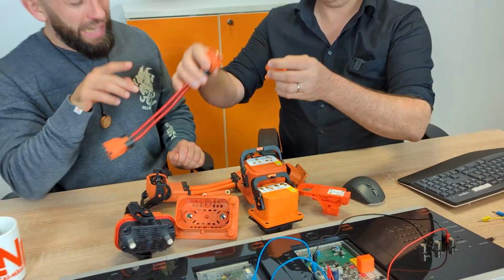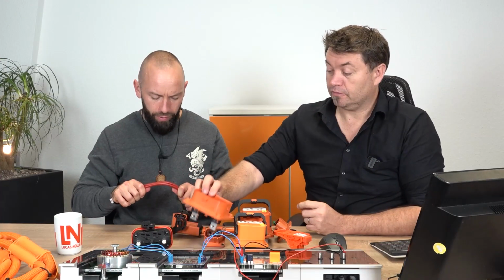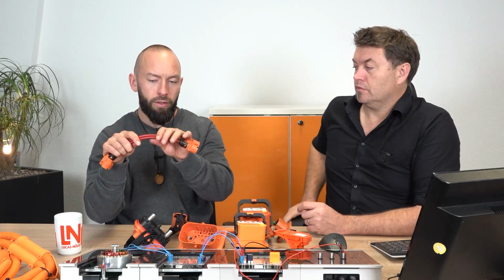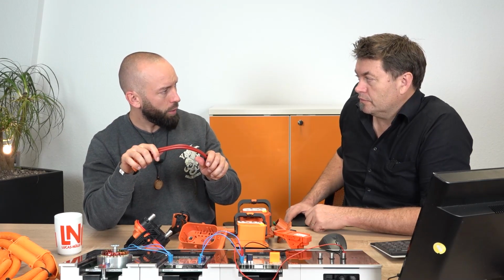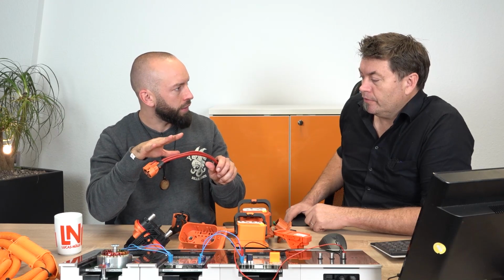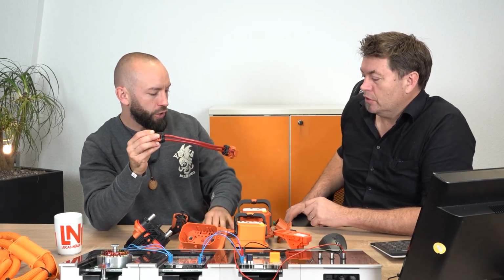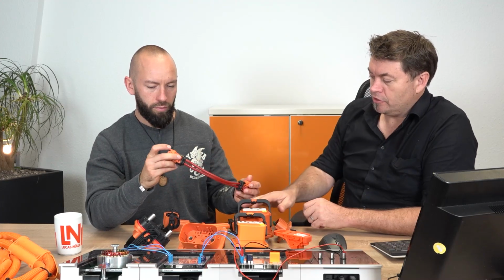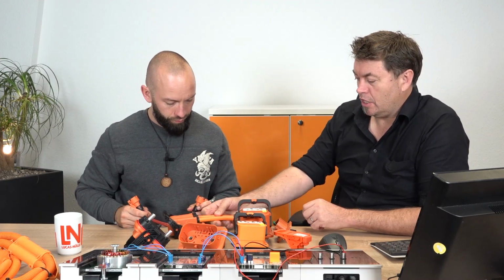But can we classically say, okay, you said these are test cables here, but what you see, and I think that makes sense regarding the color, is that the size or the diameter of this cable is smaller than this. So basically what is running through the AC compressor, the electric, is lower energy than what runs through the battery or anything like that. Basically, yeah, because it looks a little bit lighter here than that guy. So obviously different connectors come in different sizes. It depends a lot on the voltage as well. So the voltage, as we know from Ohm's law, the higher the voltage, the less current. So if it's a lower voltage, you have more current. Okay, I see, yeah.